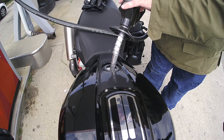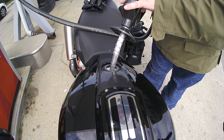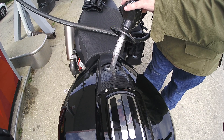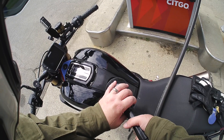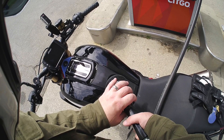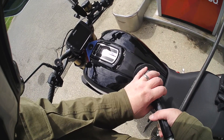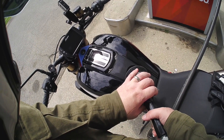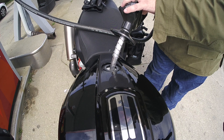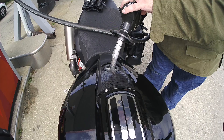As you can see, I don't put the nozzle all the way down in the tank. The filler neck really doesn't have a lot of space between the part of the tank that comes under the filler neck and the bottom of the filler neck. So if you jam the nozzle all the way down in there and squeeze real hard to get the gas flowing as fast as you can, it's going to splash back up at you, make a terrible mess. You're going to get gas all over your paint, your seat, and your hands — if you're leaning over, you might even get it in your face. What I do is squeeze it just a little bit so that the gas comes out at a fairly slow rate.